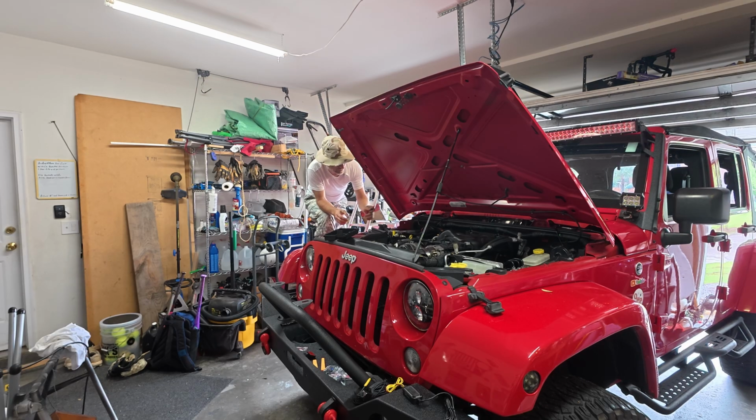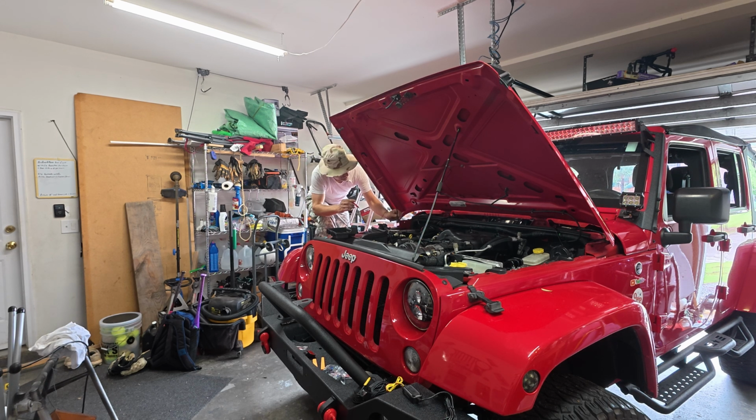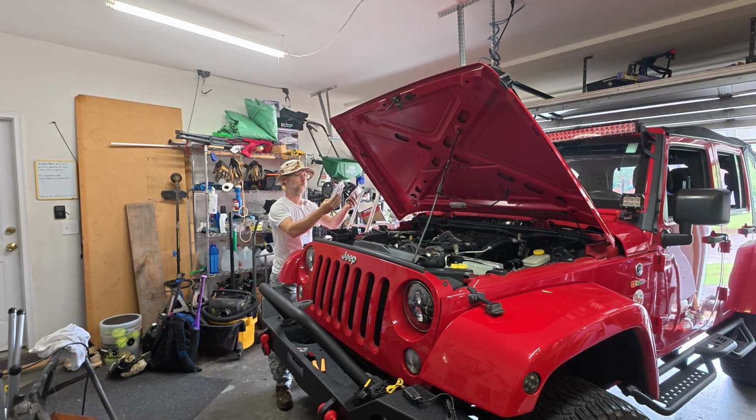Okay, so the first thing I'm gonna do is try and find a fuse to get my accessory power and my constant power. You'd think this would be easy, but I have no idea what would be powered on all the time. Tell you what, I'm just gonna pull the first fuse, see what happens. Just grab this guy right here, put my tester on the battery, and shove this little thingy in here. Whoa, that never happens. 12.6 volts, first try. I will never do that again. Okay, so I've got my constant power. Now, hopefully they gave me fuse taps.